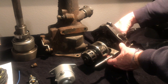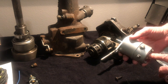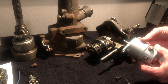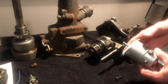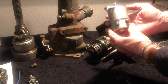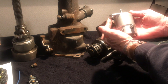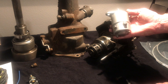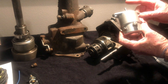The components include the solenoid — this is an electromechanical solenoid. When voltage is applied, 12 or 6 volts depending on your vehicle, it pushes the shaft out and the shaft engages a pawl, which we'll talk about in a minute. To test the solenoid, there are two terminals. The terminal on the right and the ground is on the case — from here to here with test cables, that pin will fire out. It's spring loaded so it'll spring back in.